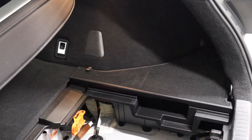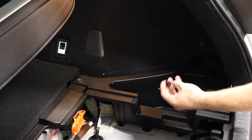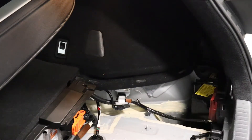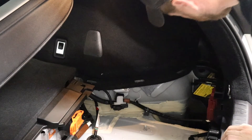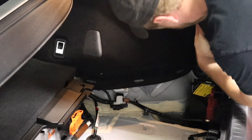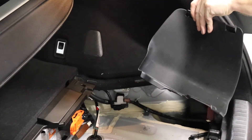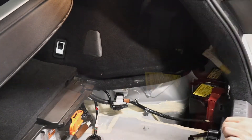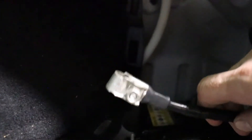To access the battery, we're going to remove more panels. You've got this little top piece here — it's held down by a little clip, super easy to pull that out. Unscrew it and pull it out. Now you can see our regular 12-volt battery there. All we're going to be doing is disconnecting it. We've got to take off this little panel here to access it — a couple more clips. That's the cover for your battery — looks like a 10-millimeter. Once we pull off the negative terminal end, we're good to go. No more worry about getting shocked.